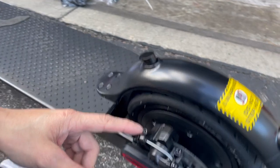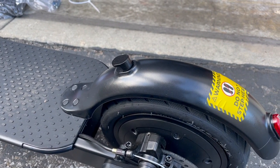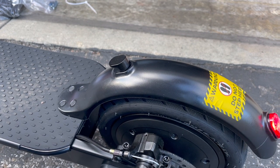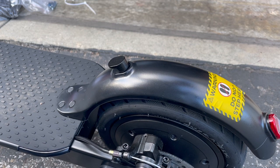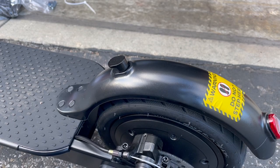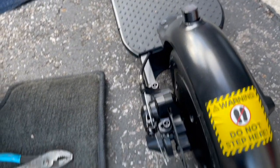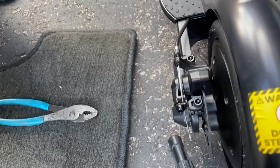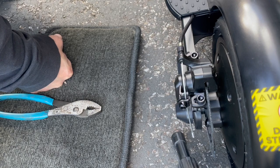So I'm going to adjust the brakes here a little bit — take up some slop. I think it's still sloppy. So now I'm squeezing and you can see — let me line it up centered so you guys can have a better look. As I'm squeezing, you see the rotor get pushed in. That's normal.